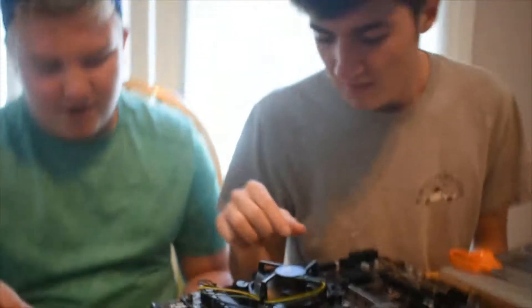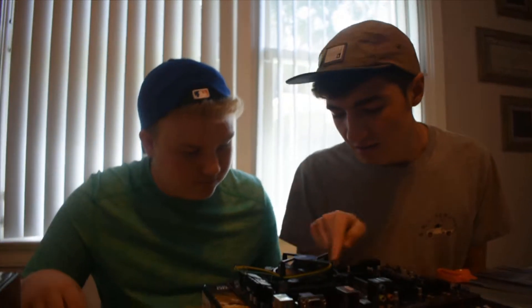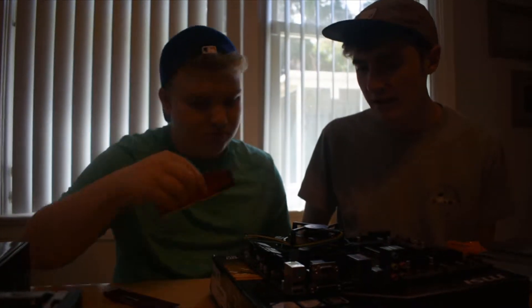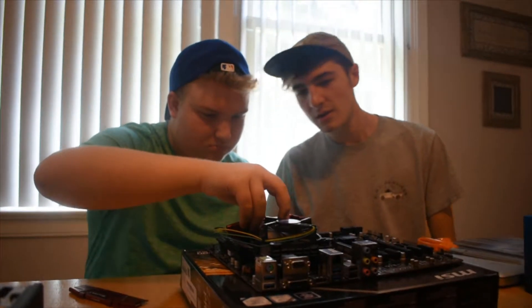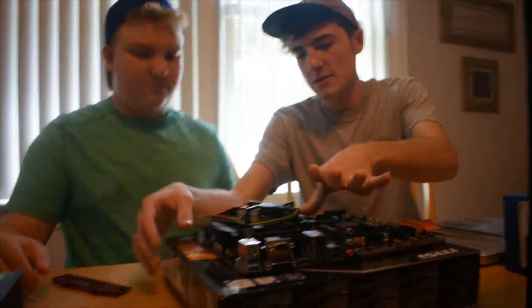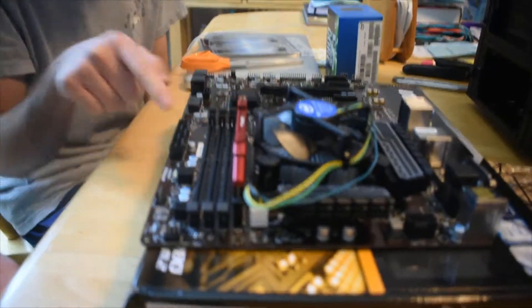Here's your RAM. We're gonna pop open all these guys. Now the trick for putting in RAM - there's more pins on one side than the other. So you want to populate this slot and this one in three. Go ahead and try to line the other side, and then this side. And then you want to push them down like this on both ends until these two snap. Give it a bit of pressure. Perfect. And do the same thing in this third slot.